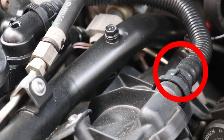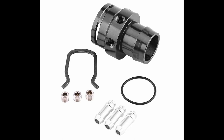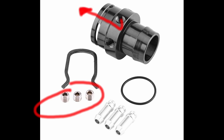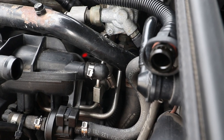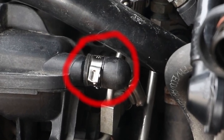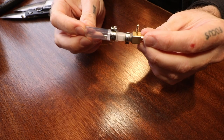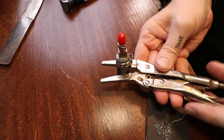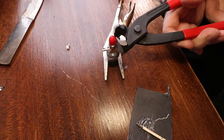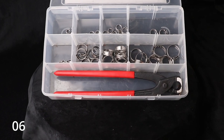One way to connect to the manifold is by tapping in at the valve cover breather hose. There are kits on Amazon for this kind of connection, but they seem to be prone to eating the screws covering the spare ports even when Loctited, so I didn't want one. I found the back of my manifold has a port that is capped at the factory. I just needed to make an adapter to connect to the 3mm airline that came with my gauge. My first adapter attempt was ugly so I scrapped it and tried again. The second attempt was less ugly and more compact, held together with JB Weld and single ear clips.